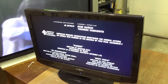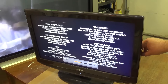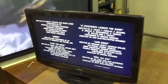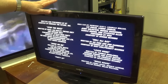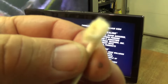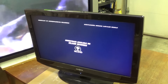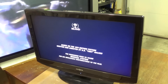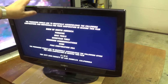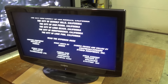Let's see if we can adjust the volume. Volume up — volume down. Nice easy fix! Loose ground screws were more than likely the culprit on this one. There was a little bit of gunge on the board — looked like maybe some remnants of rosin from manufacturing — that could have been the problem, but I think it's safe to say it was the loose grounds that were the issue. I hope you enjoyed this quick easy look at an Insignia TV where the menus were cycling. Have a good day — we'll catch you in the next one, bye bye.